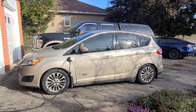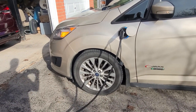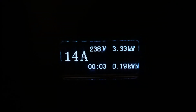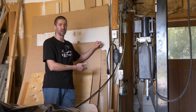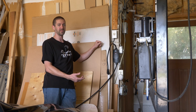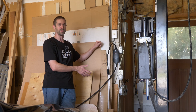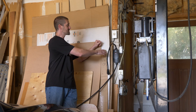This is going to come in really handy for plug-in hybrid owners. In my family, my brother drives a C-Max Energi and my mom drives a Fusion Energi — both charge at 3.3 kilowatts, so this is the perfect size. With a plug-in hybrid, it gets charged up in about two to three hours. So if you're a satellite-type driver — going out shopping and coming home before heading out again — it gives you just enough time to recharge and get that 30 or 40 kilometers again in the same day, using even less gas.